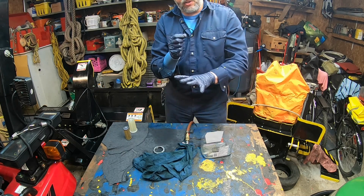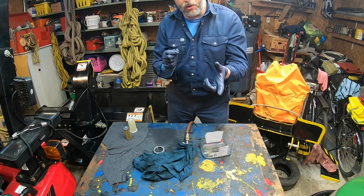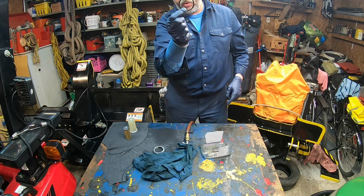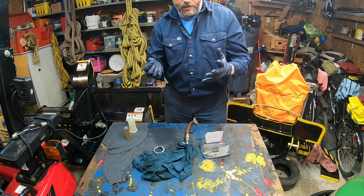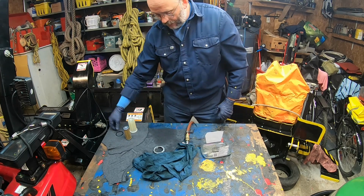So yes, the tractor is good with the first fuel stage. It's a strainer, and also water separator. The second one, it's a fuel filter, and that O-ring fits on both. It's basically the same canister. So this one I'm gonna keep and clean.